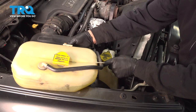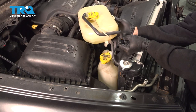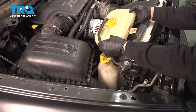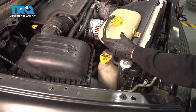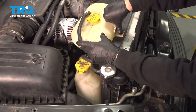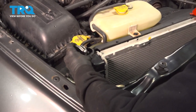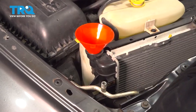Take your expansion tank, swing it around, and don't forget to remove the plug — if you put a cap in here, go ahead and pop that out. Swing this over and put the two tabs on the bottom into the shroud, then line this up. If you have a bolt here, go ahead and install your bolt. We have a plastic push clip, so go ahead and pop that in. Go ahead and open up your radiator cap and use the appropriate coolant recommended by the manufacturer. Drop your funnel in place and go ahead and top off the system.